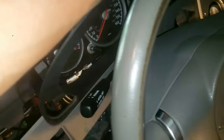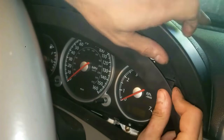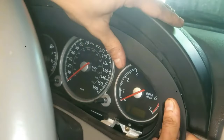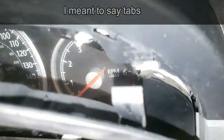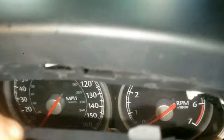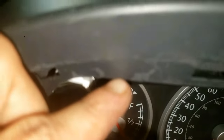Make sure the steering column is clean before you put this on. Now I'm on the right side, pushing this down and in. Take a look at the grooves right here — put some light on it. This groove goes right under there. This groove does not go in here — it looks like it, but it doesn't; it just goes underneath here. These two go under this big groove right there. This groove goes right here, and then this one goes right in there. This goes right there on the inside, and the same for that.